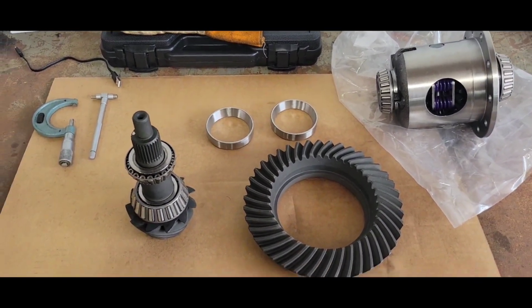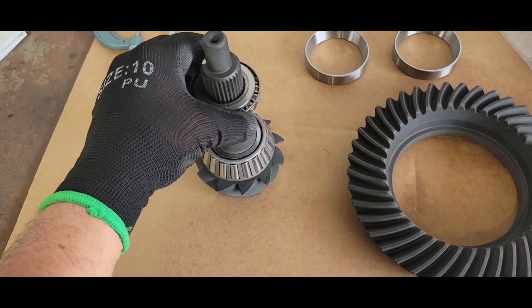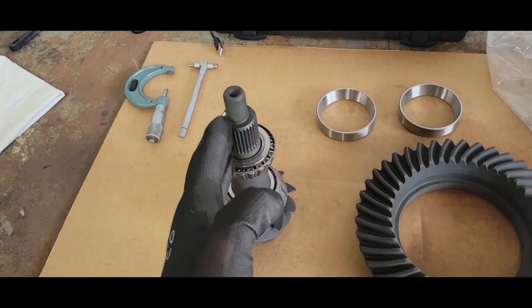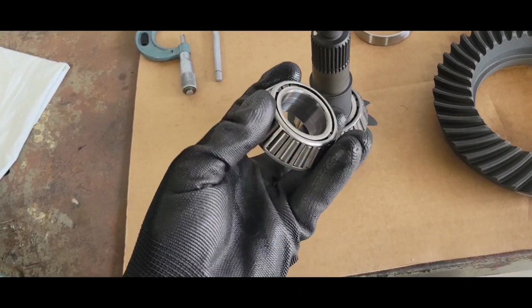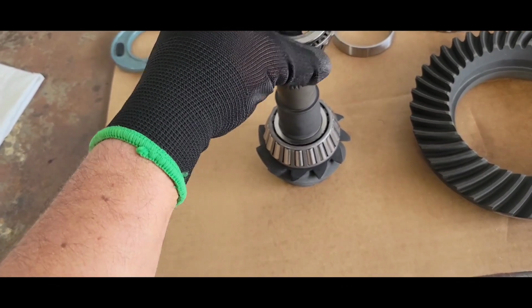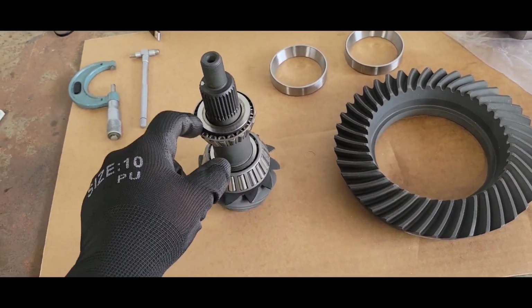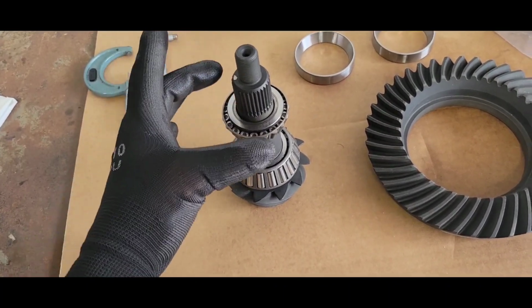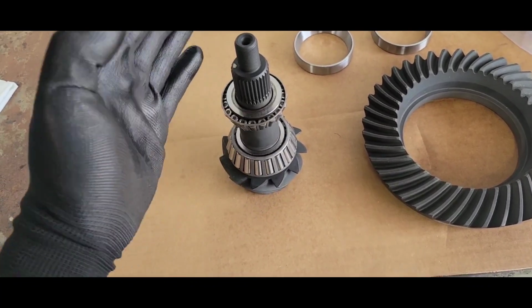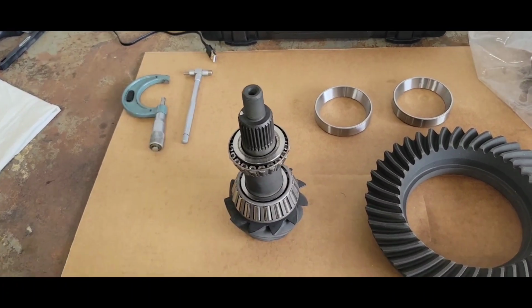Well, it's assembly day. So there's the bearings I bored out at work. I got them nice and slip, nice and concentric to everything, so I'm getting a nice good reading. I see a lot of guys take Dremels and aggressive tooling in here and open them up, and yes, you get them to fit, but you got to be careful doing that. You want to take as equal an amount as possible on there. You don't want to lose concentricity and get this bearing cocked. And you can, a couple thousandths out of there on the wrong axis, these bearings will not be nice and square.